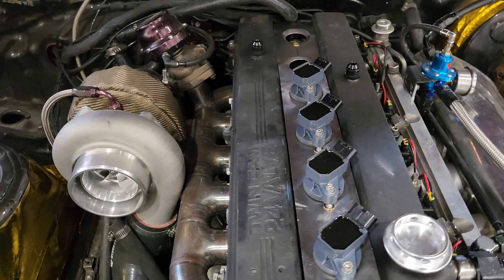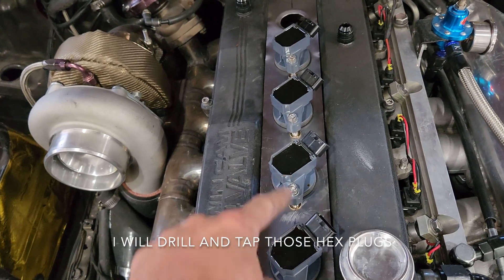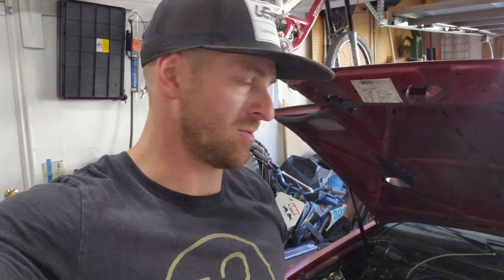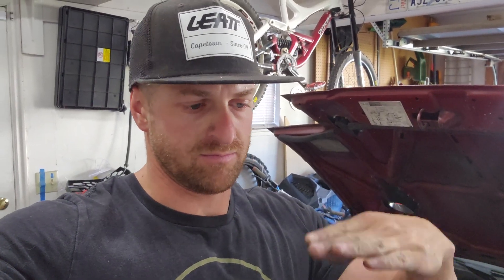Looks pretty good. It's a little off, but there will be some bolts — so there's one of them, they'll have like one there, two, three, and then four back there, and that should hold the whole plate. When I get the other coil packs, I'll throw those other ones in there, get those bolted in, get those little spacers. I'll have to make six of them, but I've got to measure the right height so when I tighten it down it makes a good seal around the rubber gasket on the coil pack. Once it's in we're good to go. These are smart coils, so I just have to wire the signals to the ECU — they're going to have 12 volts and then wire somewhere to the engine block. Should be pretty straightforward.